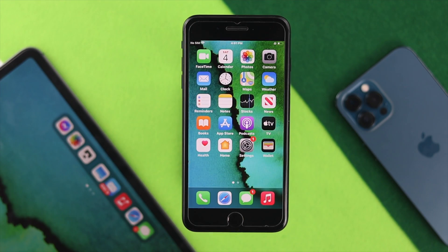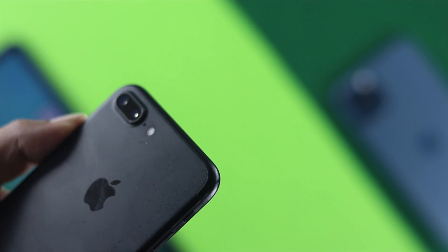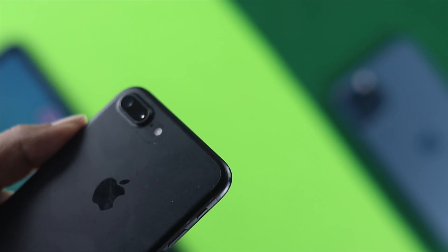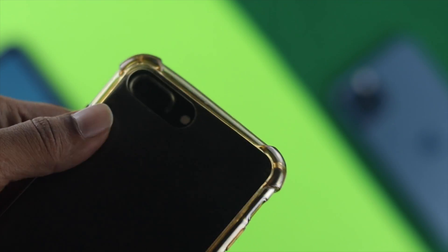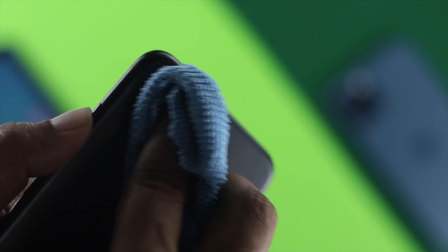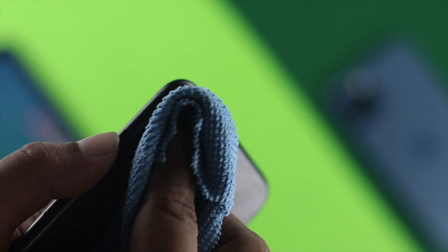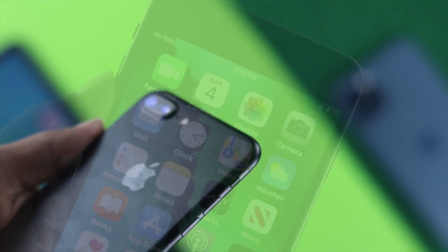Next, take a look at the camera itself. Sometimes if your camera has a lot of dirt on it, or if your phone case is covering up the camera lens, that can cause this issue. So do two things: first, clean your lens with a soft fabric cloth, and second, remove your phone case and check whether the problem is solved.